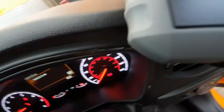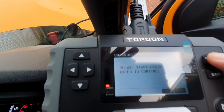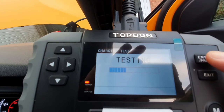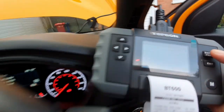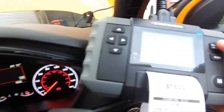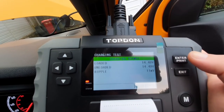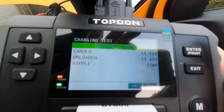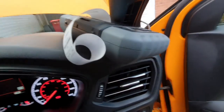Going back to the main menu, clicking down to 'Charging Test', click enter, then enter again — please start the engine, press enter to continue. It gives a little graph and runs a test, then asks us to increase the engine speed to 2,500 RPM. Getting the revs up, clicking enter again — it runs another test. That's finished: charging is normal, charging at 14.5 volts. It also gives you the ripple voltage. Clicking enter prints the results, and clicking M takes us back to the main menu. Turning the car off to look at the printouts.